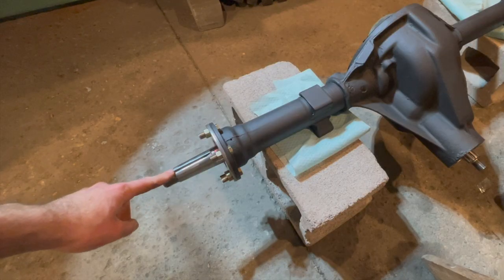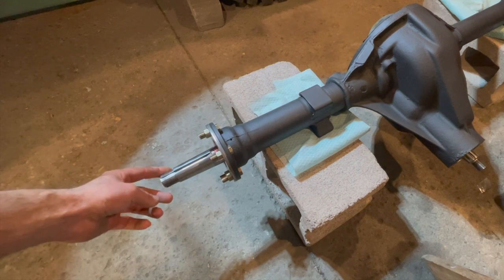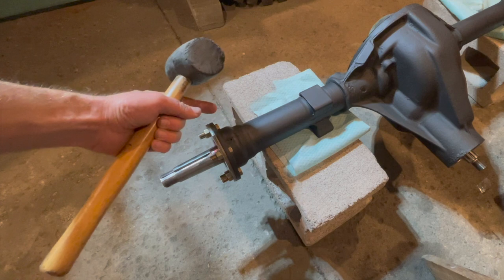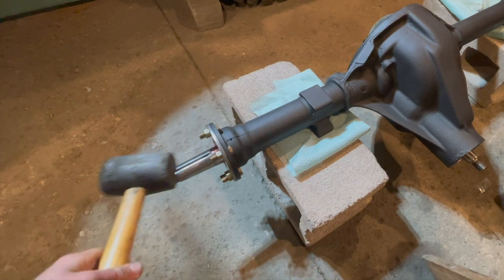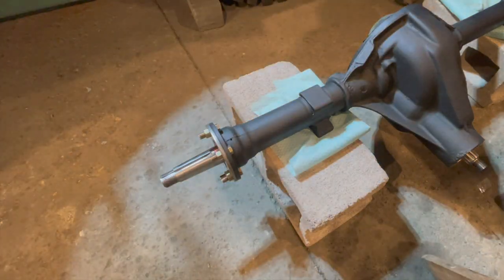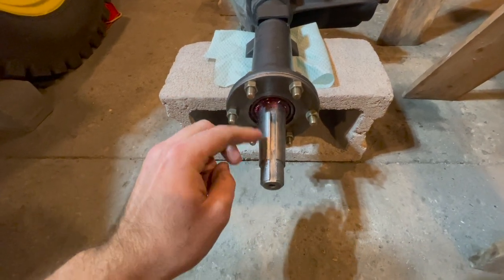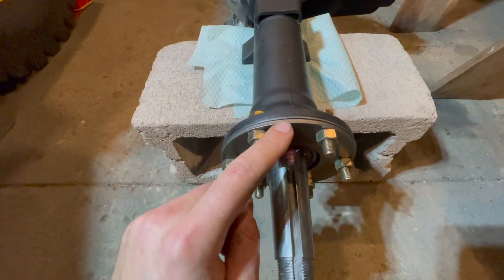Make sure when you get one side set, you shim them to the same amount of shims on both sides and then test the dial indicator on both. One critical step before we mount the dial indicator is we have to use a rubber hammer to give your axle shaft three good blows. That will send your axle shaft all the way to the other side against your bearing retainer. After hitting both axle shafts with the rubber hammer on both sides, we now know the bearing on the inside is pushing against our bearing retainer.